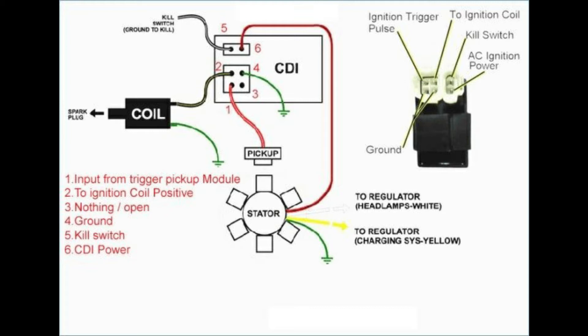First, we're going to create a jumper wire from pin number four directly to a good grounding spot on the engine. Being very careful not to break the pin, we're going to take out the number five wire from the CDI plug directly at the harness. We can use a sharp tool like an ice pick or a paper clip to achieve this. Looking from the front of the plug, you'll see small metal tabs on each pin which secure them to the plug. Push the tab down and the pin will release — but don't use excessive force here.